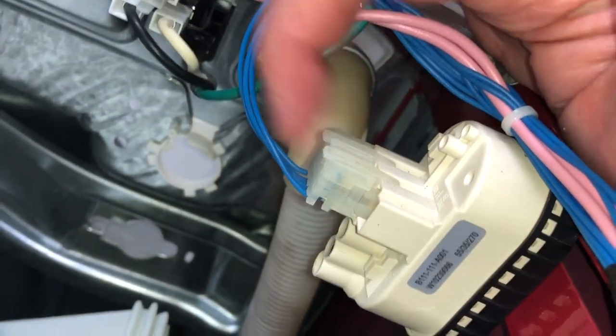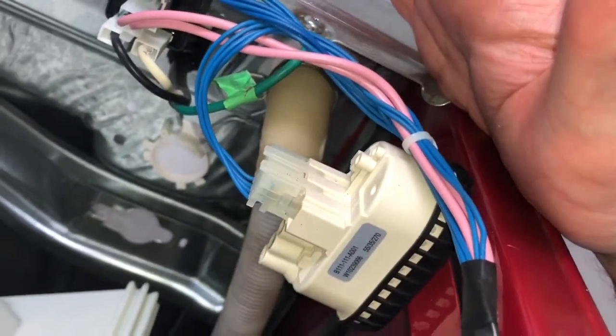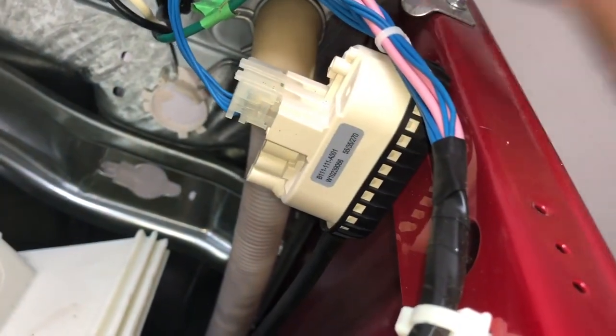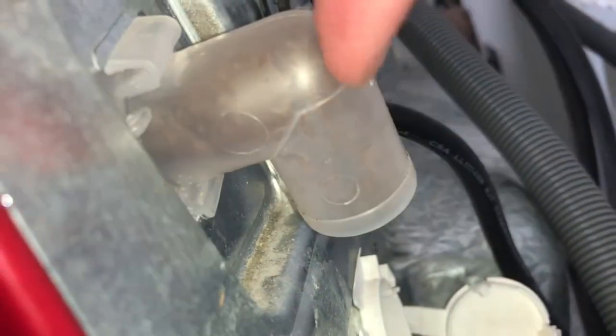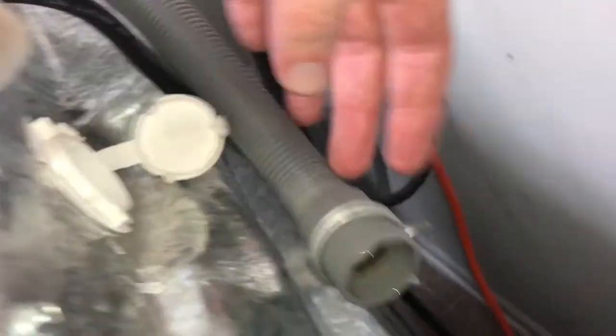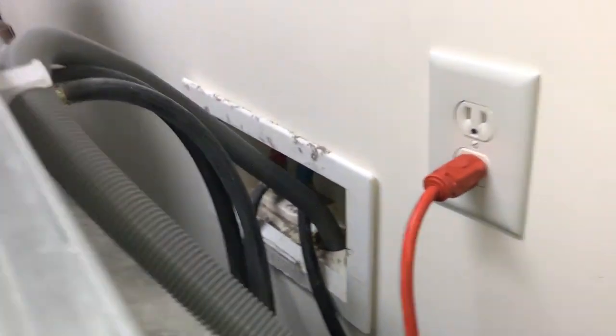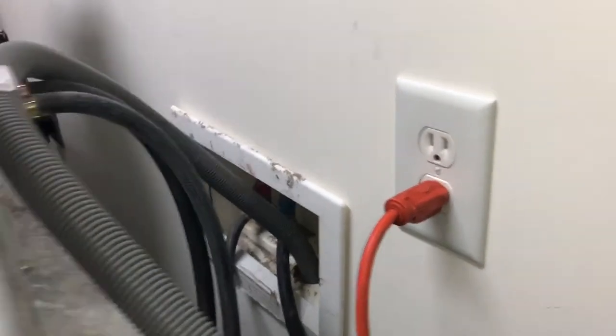Dry as a bone folks. Took everything off here — took the paneling off, three screws, just three screws. All our seals look good. No shimmies, no changes. Drain hose looks perfect. No water there. Really you're just looking for leaks. I don't see anything. There you go. I hope you enjoyed it. I'm now in it for $28 for the new pump, plus $13 for the pipe clamp, so about $41 and change total. I lost a weekend but Amazon Prime got the part in within a week.